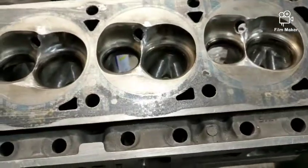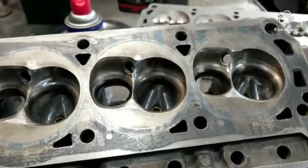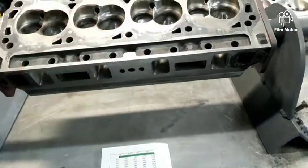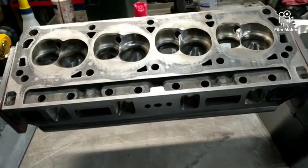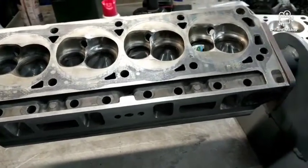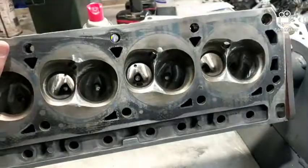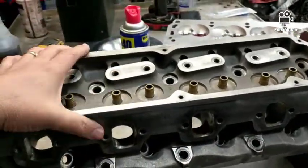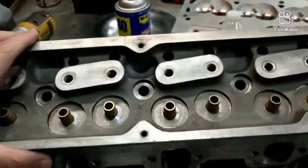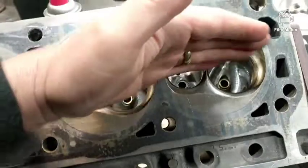The reason I'm showing you these today is because it's like 40 degrees out and I really need to be bringing Vincent's silver car in — the drive gear off the output shaft on the transmission came off, so the speedometer doesn't work. The SN cars are finicky on the tune and apparently use that speedometer information for running the engine, so it's kind of missing that information. I've got the other transmission ready to go in, but I'm trying to find excuses not to lay on the concrete floor in the cold, so I started on this instead.